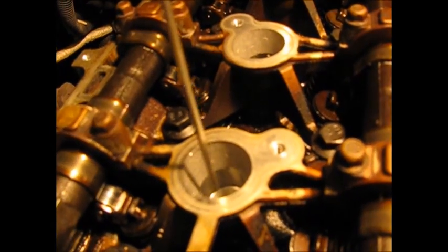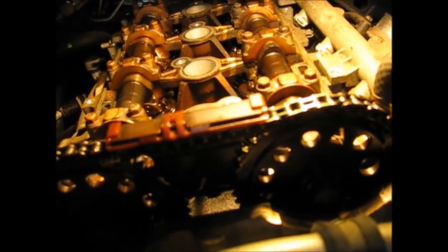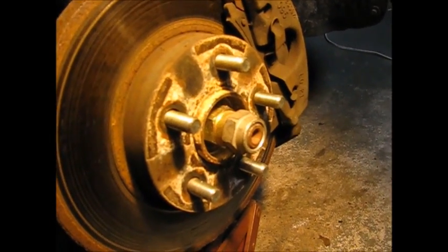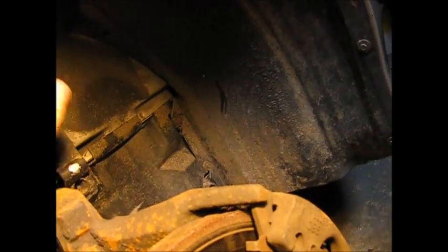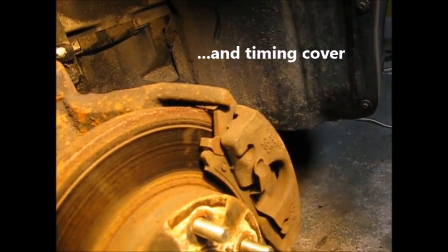Here's my indicator of piston position in the cylinder — the lower mark means piston at top dead center, the longer mark means piston at bottom. Spark plugs are out, the indicator is in, and it's at the lower mark — so the piston's at top. With the timing chain having jumped, the relationship is lost between the two cams, and that's why we're not getting any compression. Check out Part 2 where we'll be jacking it up, setting it on stands, removing the right front wheel, this cover, the crank pulley bolt, crank pulley, drive belt tensioner, and finally the timing cover. Stay tuned.